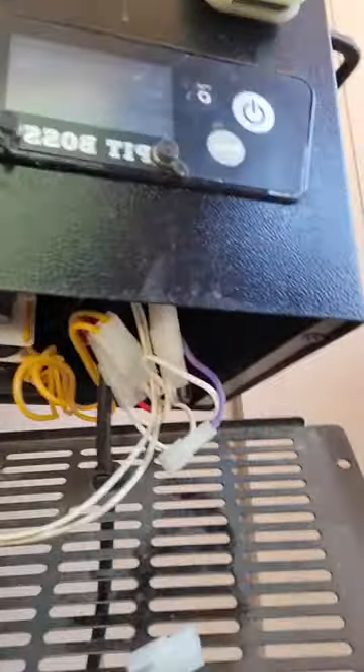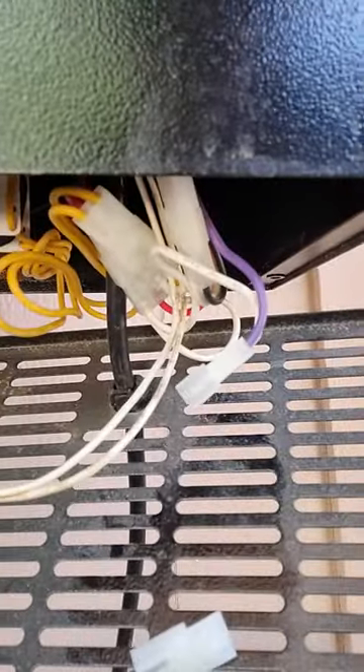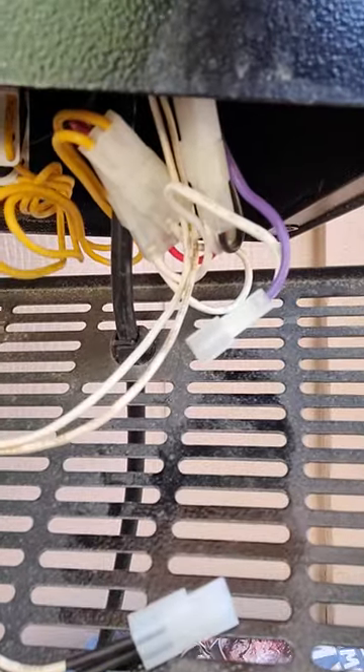Quick and easy way to know. If you have any pellet smoker, you find out what wires connect to the heating element inside the smoker. I'm going to bring you down here. Here's what I did — that purple and white wire is your heating element, or the wires that power your heating element right here.